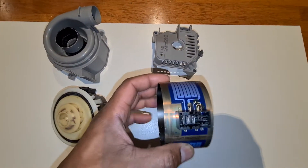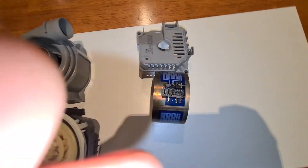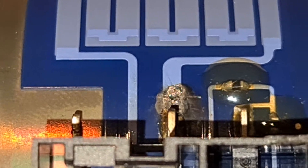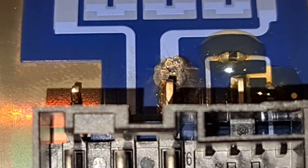Here is the heating element. You can see just over here on the heating element we have a burnout, and that's what's causing our earth fault — so low insulation resistance. It's just burnt straight through the heating element base. That's what's causing that.